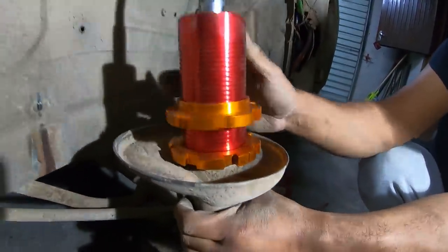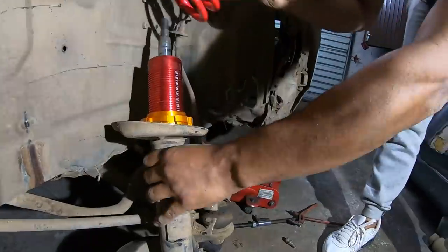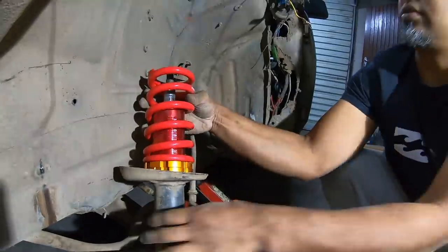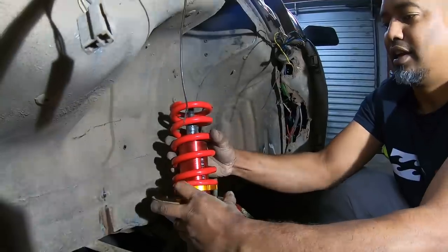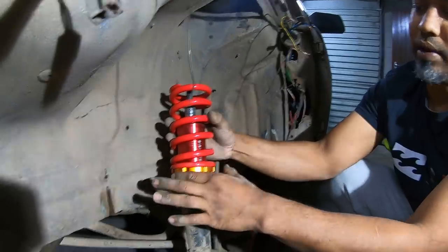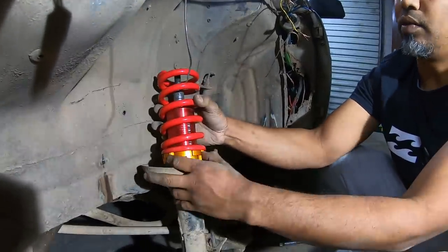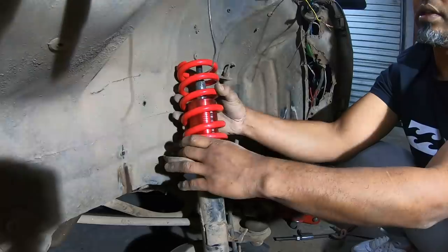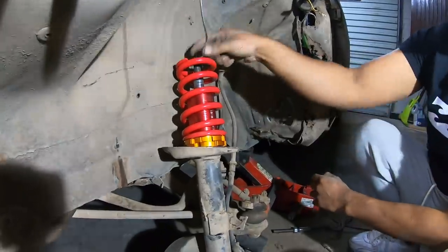Now that is your sleeve-over over the shock. As you guys can see there, that's how low it can go. Your spring goes over. There you guys have it — up is higher and down is lower. The reason for there being two collars is when you lock these two in place, it won't shift. It won't go up or down — so you lock it. Hence why you'll find these two spanners in the box.